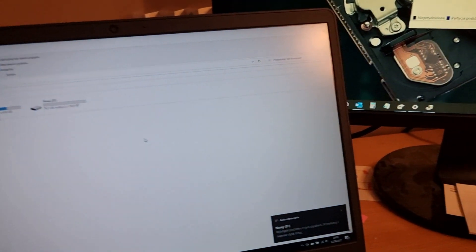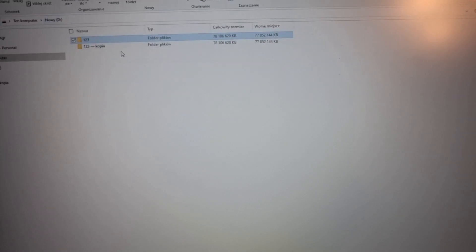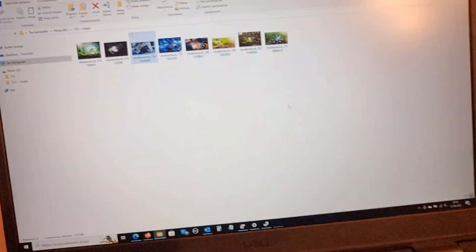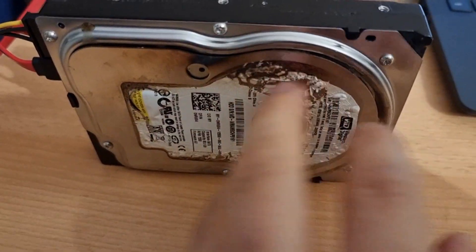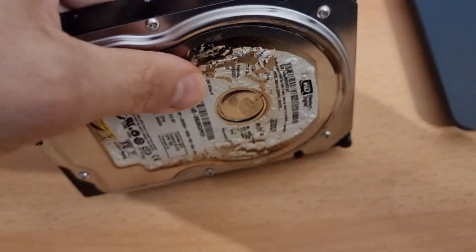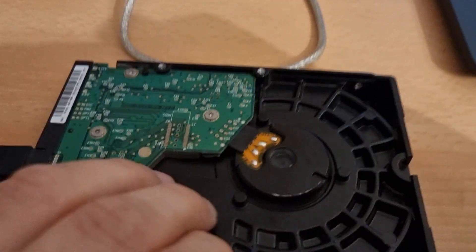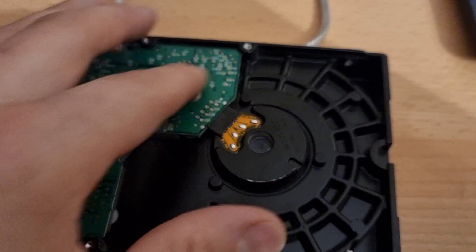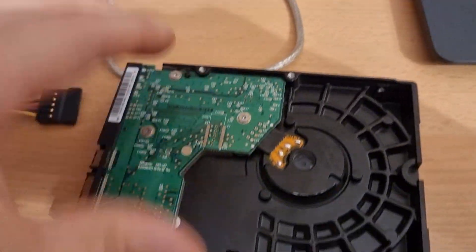Yeah, this time we've killed it. No — just up here. Safe and sound, no problem at all. Undisruptible hard drive. Even after frying it, it doesn't die. The heater just heated the surface so the rest of the hard drive wasn't affected. The magnet didn't kill the data. So it's pretty hard to destroy the data on a hard drive, especially when it's double-shielded — one cover plate is magnetic, the second is stainless. The magnets are somewhere here and there are the platters. We can open it and use the magnet directly on the platters — let's see what happens.